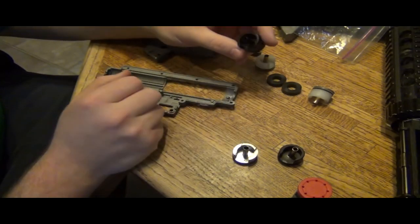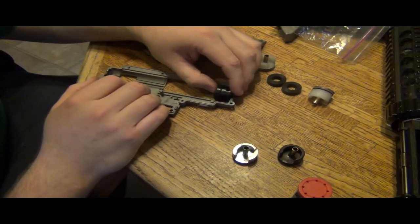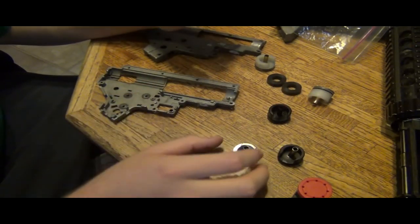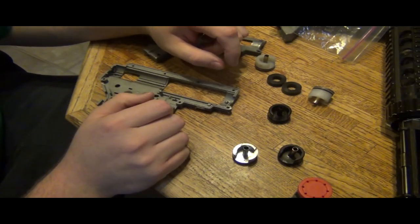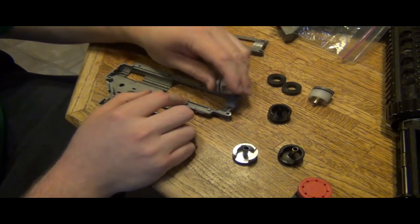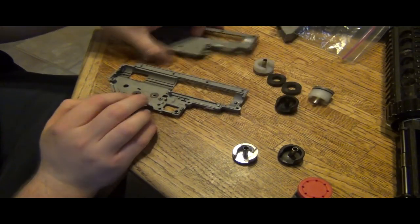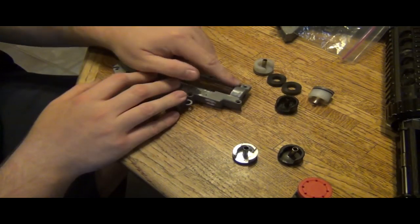This is just a very interesting little look. I sat down and thought about it and went: why did this shell crack compared to other builds that didn't, whether they had Sorbothane or not? There was a different cylinder head in here. I don't have one on me to show exactly how it fits, but I'm very positive the difference is it was not touching the front at all — instead, it was just touching those mounds.